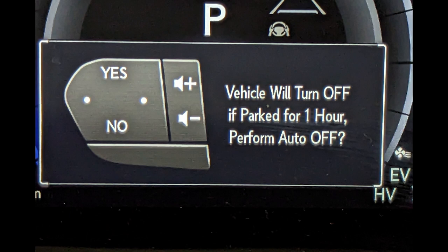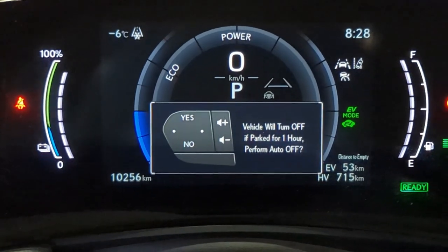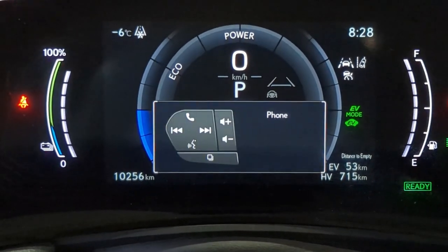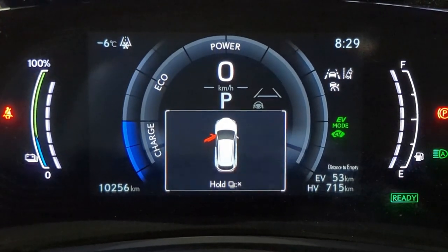One thing that you probably want to do is turn your auto headlights to really the daytime running lights so that it doesn't use all the juice while the vehicle is running, and that probably will be fine. But if the weather is extremely cold outside and your garage is still minus 10 degrees, you now have to be careful of the gas engine starting. So it is critical to know what the condition of the weather is, and whether that is something that you want to do.